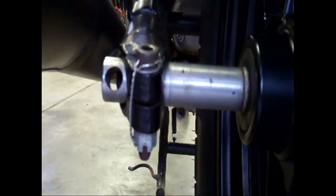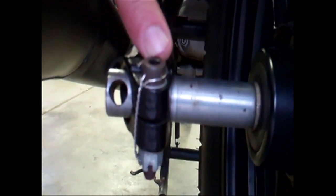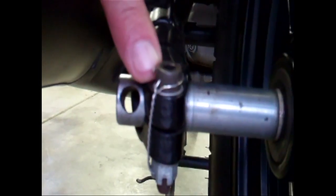In the same way we used on the front axle, we replaced the rear pinch bolt with grade 10 Allen hardware so I had parent material to drill through for the safety wiring. Going down to the bottom side, I also used a castle nut, also grade 10, to retain it rather than drilling through a factory nut where I might lose the temper.